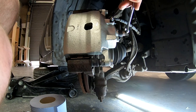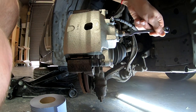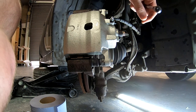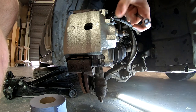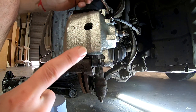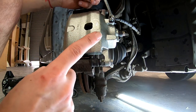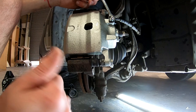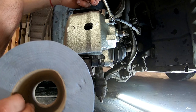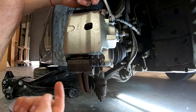We don't have any leaks anymore — I just had to tighten the bolt even more. These are called copper washers, but they are actually crush washers. You need to crush them. Now as the car is on, we should not see any drips. I'll press the pedal so the brakes are on — if I open the bleeder and hold the blue paper, the fluid should squirt out, not drip down, but squirt out.